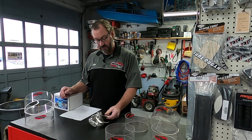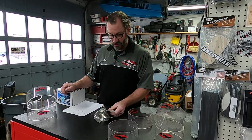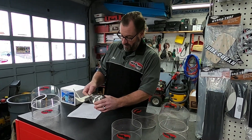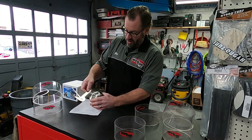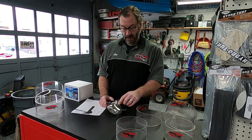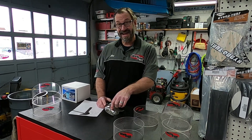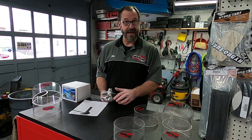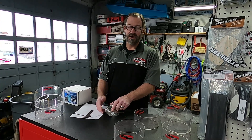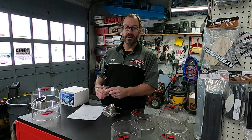Today we're going to quickly look at this impeller — it's a hooker. I've got a machinist rule here and I measure around starting at the leading edge, making a mark at a one-inch increment. Every prop is a little different. Generally, the leading edge we measure the first inch, and the same thing with the trailing edge — I'll measure approximately an inch. You can make adjustments and change it more or less depending on what you want to do — whether you need to gain RPMs, lose RPMs, gain bottom end, or more hookup. It's going to be a trial and error thing. There is nothing that's 100% the same for every application, every ski, every engine and pump combination.